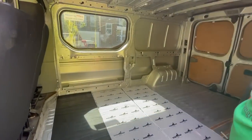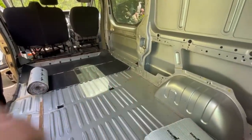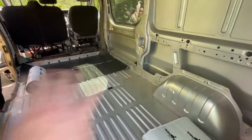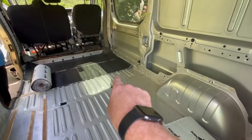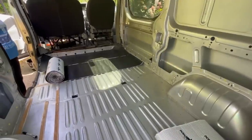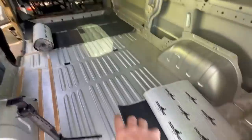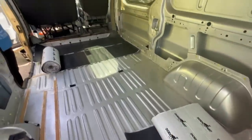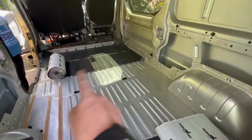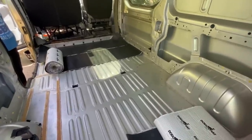Trim the corners off before it goes in. First mistake I made: we measured the distance of the van, which is great, and those sheets would have fitted, but because we're taking into account the contours of the floor it would have used more. So basically we're using the first one now as a guide. We're going to move all three sheets to the back area because it's shorter between the wheel wells, and we're going to attempt to roll it out and then trim it once we're done. Live and learn.